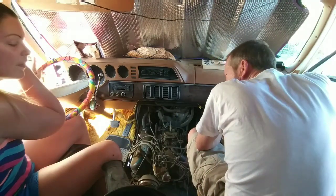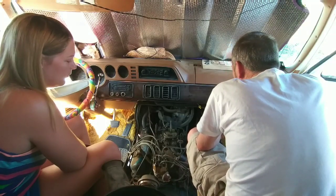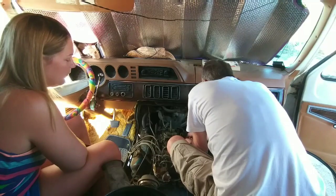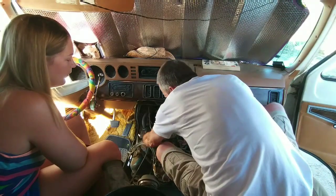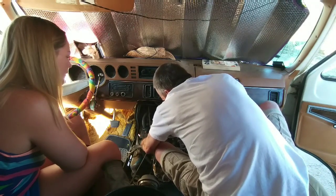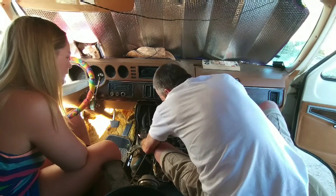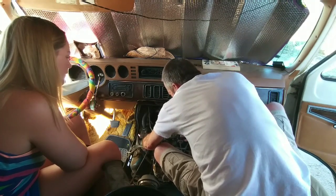And so, considering it's an old engine, everything. But boy, I wish you could figure out why it's running so damn lean. You know, a little bit of wear in the throttle shafts, but that's actually pretty normal on these guys. That's the main throttle plate that's down underneath this one. There's another one of these underneath this one, and that's the main throttle plate.